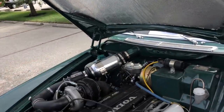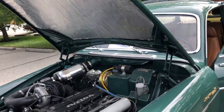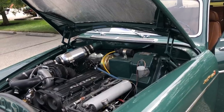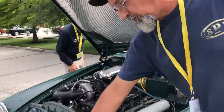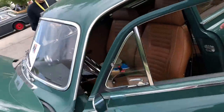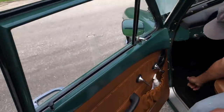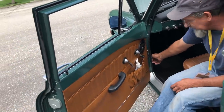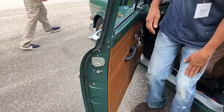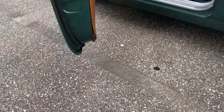I love using the cowl as the intake - I had nowhere else to go. And in all race cars that's where they put them. It's the cleanest air and the highest pressure point. I put vents in the floor too, so it goes back to fresh air as well. You didn't just close off your fresh air, you redirected it. It comes in through these doors that open and shut - like an old car or like the 140s have with the side flaps. I can open them halfway or all the way. Coming up this morning with the window shut I had air blowing up my pants leg - so it's definitely working. There's no heater box, no heater, so there's a lot of space underneath.